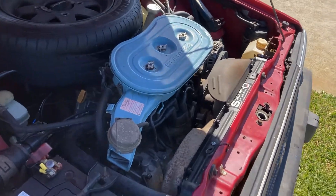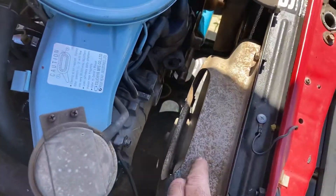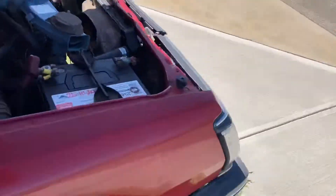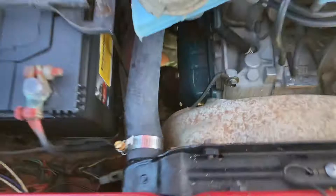This is Dave from Subarino, just going through how to test electric fans on a Subaru Brumby. Step one, turn ignition on — the light should be on on the dash. Now these are triggered by a thermo switch on the driver's side of the radiator. You can see it there, the yellow wire on it.